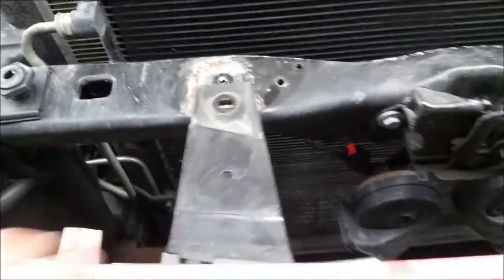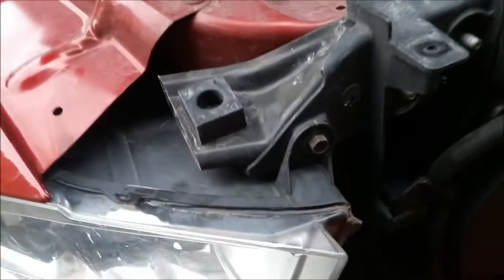To get to your headlights, you remove the back piece — there are just clips — and then there are four bolts on top. The grill starts moving and you have to unclip it; it just pops up. You can look on YouTube for how to do that. Then go in the back, remove two bolts, and the headlight pops out. Here's my stock headlight removed — I already had HIDs installed in my stock headlight.